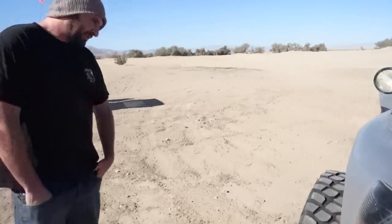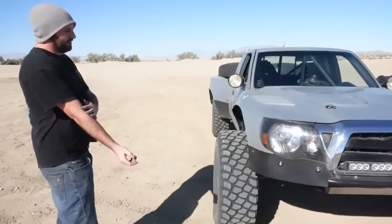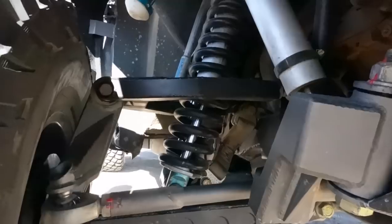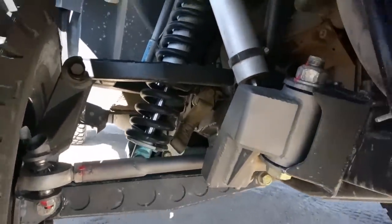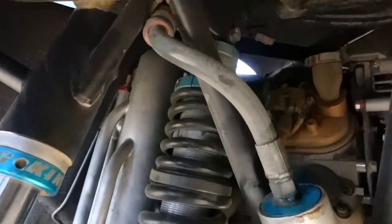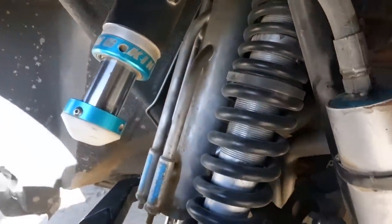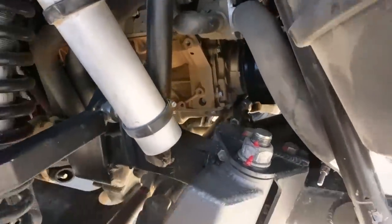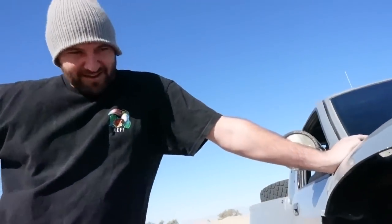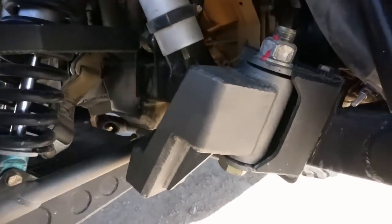So take us through the front of this thing. It's got a six-over JD kit for the two-wheel-drive version — notched the frame rails to get the extra two and a half inches of up travel so it could also sit a little lower for ride height. Then it's got a three-over bypass 2.5 coilover with a bump stop shortened down to a two-inch stroke, just shimmed it. It also has the race kit arm — one of my buddies called it the 'baby arm' because it's just massive. And it has a hydraulic ram assist integrated under the skid plate — it's packaged in there pretty tight so it's hard to see.